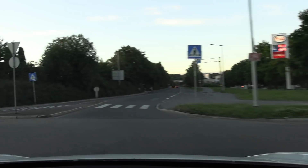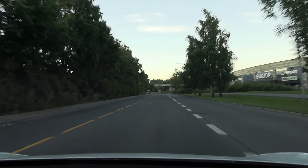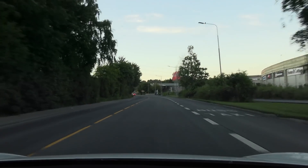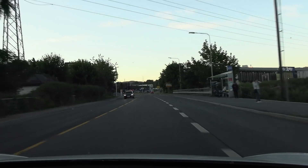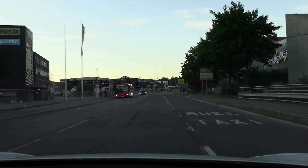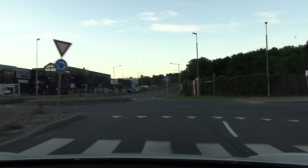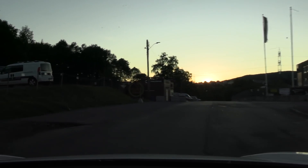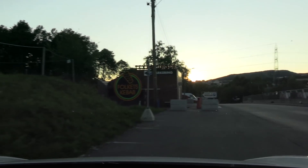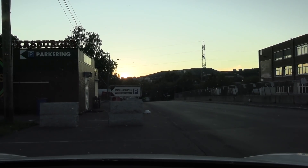The instrument I use doesn't lie — it tells me that these exact windrun tires on the mag rims create more noise than the Turbine X rims, which are aluminium. So maybe I go back to those. I want to go back to 18-inch. If you guys have something you want me to test — for example consumption — that's really hard to test because the weather might change and you'd need the exact same tires. I believe consumption difference isn't that much at constant speed, but if you accelerate and decelerate a lot then the wheel weight might make a difference.